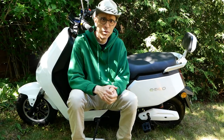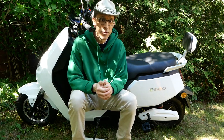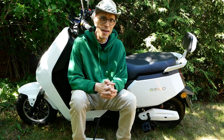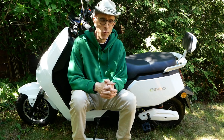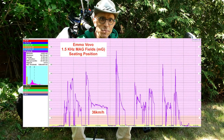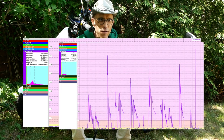In the back here there's a large DC brushless motor, and at some point I really should measure what's coming off for magnetic fields here in the seating position. To make a long story short, I was shocked at the levels that were coming off this thing. I'll show you in a chart here — sustained magnetic fields around 1.5 kHz, the motor controller frequency — I was seeing around 10 mGauss and peaks were 45 mGauss.